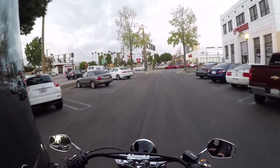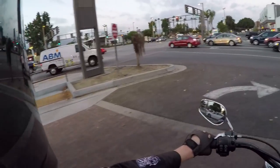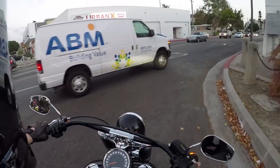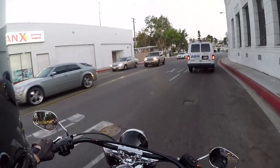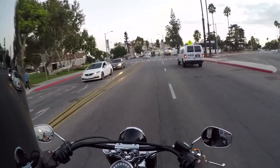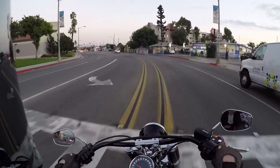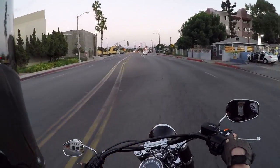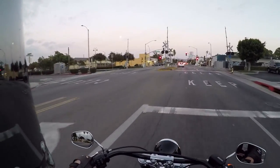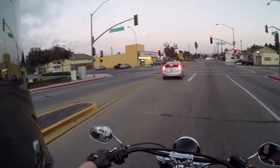So I pulled out my mic there for a second so you can kind of hear the engine rolling at an idle. Harley-Davidson did incorporate an additional counterbalancer in the Milwaukee 8 engines that were installed on those Softails. So in the touring bikes, when the Milwaukee 8 first came out in 2017, they had a counterbalancer in the front. Now they still have that counterbalancer, and they added one between the flywheels and the transmission in this version of the Milwaukee 8 that's been applied to the Softail models.